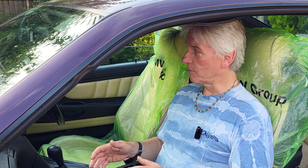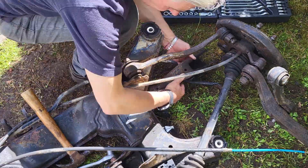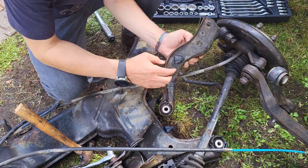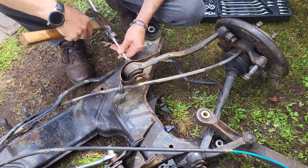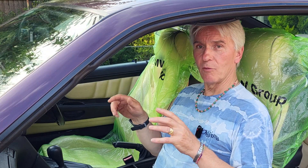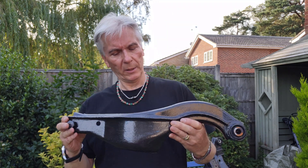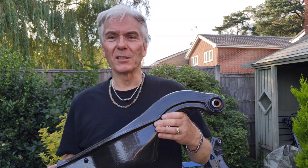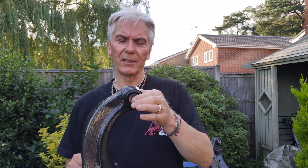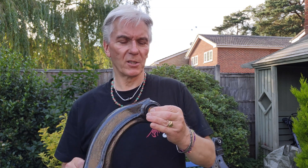In the intervening period, I've had a complete rear suspension from another E31 in the garden which I took apart. I now have two axle carriers and I'm using the one that came with the complete rear axle because it hasn't got a bent handbrake cable eye on it. For the lower suspension arms - cross members or spring carriers - I've refurbished them myself: they're black Hammerite coated as we always do in England. I've redone the spherical bearings, completely cleared out with brake cleaner until there's no grease at all. They were still quite tight so I was happy with those - lots of new grease and new boots so they're nice and tight still.